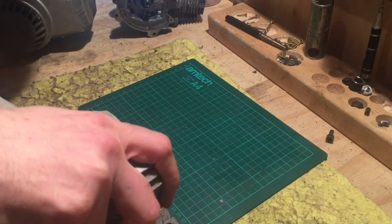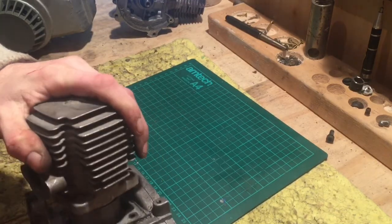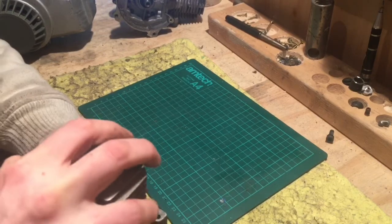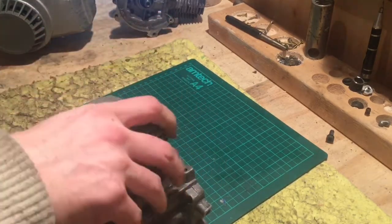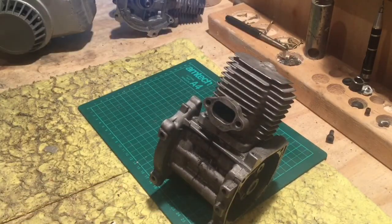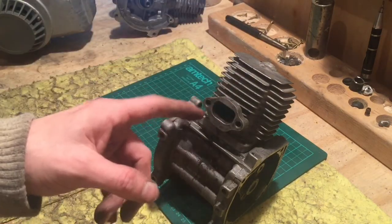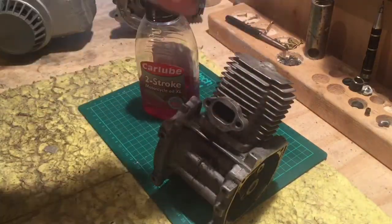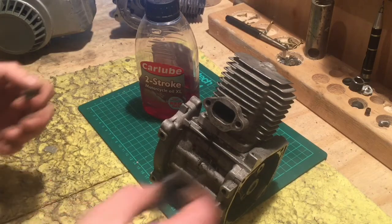That was it — our second ring had jumped. Just lightly press down as you follow the ring around, pressing it inwards. And boom — that never quite went to plan, but there we go. When you're putting your head back over the piston, you really want to get some two-stroke oil — doesn't matter what it is — and just rub it all around the rings and the piston, and up inside the barrel. Just so everything's lubed and gives it as little chance of friction as possible.